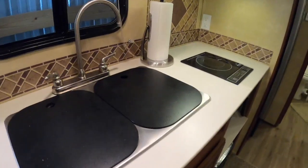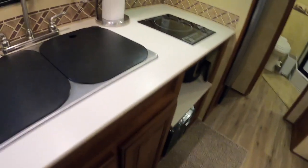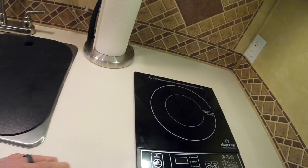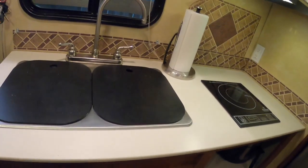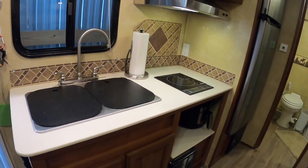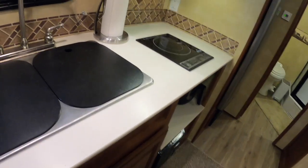Countertops are fabricated, and what's beautiful about this stuff, as I mentioned earlier, is you can just use a jigsaw that you have at your house, or your table saw. I recommend carbide tips on all your blades, and then just a regular router to put the bevel on the edge. So I've got it all mocked up in place. I need to glue it down, which is going to be the next step, but everything's just kind of loose in here, ready to go.